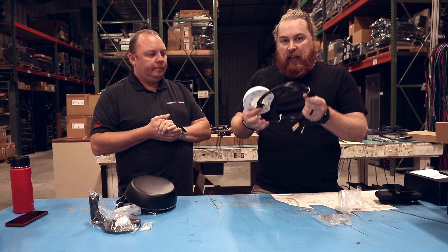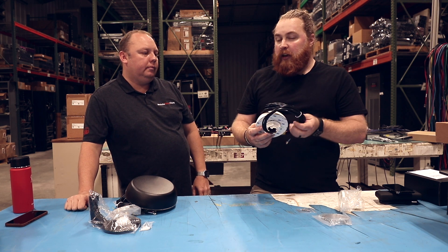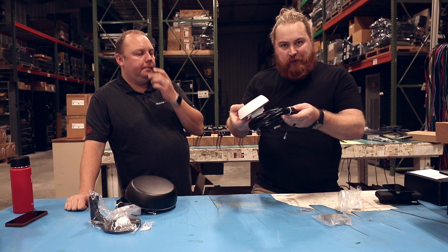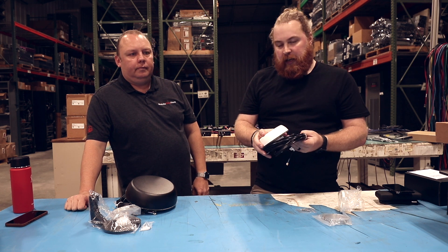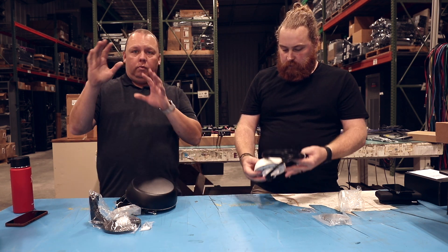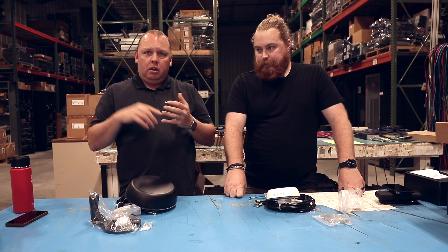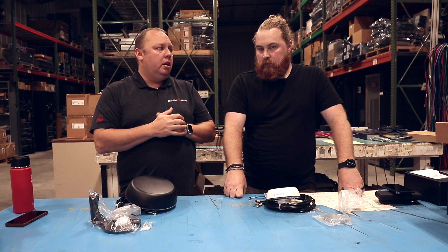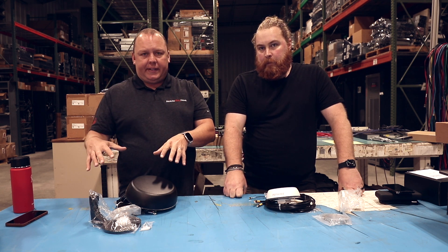This is a really great option. This is a 5-in-1, so your typical modems are going to be like the BR1 MK2 — that is a Category 6. It basically has two LTE, two Wi-Fi, and a GPS, and that's what this is lined up for. If you're doing a single Category 12 modem kind of combination, this would work well too. It's got great flexibility. These do support 600 MHz, so for folks interested in T-Mobile's rural band it will support that, and they are 5G compatible as well for future-proofing.